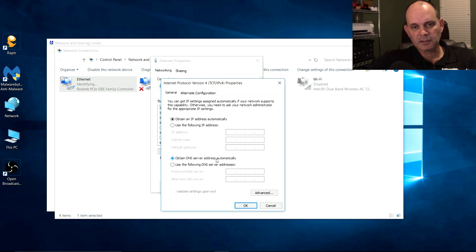That's it for the configuration of the secondary router. Now go back to your network adapter settings: right-click the network icon, open 'Network and Sharing Center,' go to 'Change Adapter Settings,' right-click the Ethernet connector, choose 'Properties,' double-click 'Internet Protocol Version 4,' and set it back to 'Obtain IP address automatically' and 'Obtain DNS server address automatically.' Click OK. That restores the regular setting. Now we're ready to connect the secondary router to the primary router to establish the bridge.